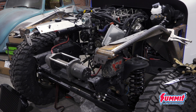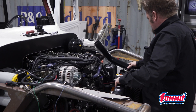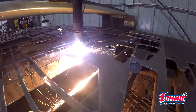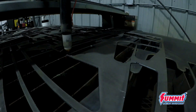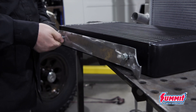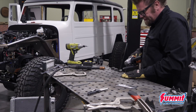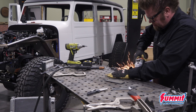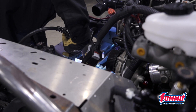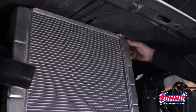Today it's gonna be all about plumbing on the bad old wagon. I'm going to start with two of the biggest pieces: the radiator and the intercooler. These are universal items that I picked up from Summit Racing. I chose these because I'm pretty sure they are going to fit the best. The bottom bracket is really simple but it does mean I gotta fire up my fast cut CNC to cut it out. Before I fully commit to the location of both of these items I gotta check for hood clearance, and with the hood in place I can see that I have plenty of room, so I can start building some boost tubes.